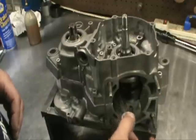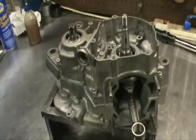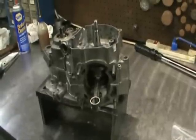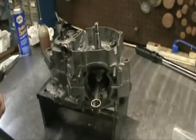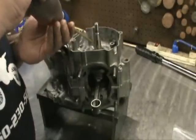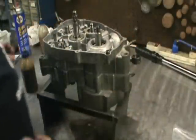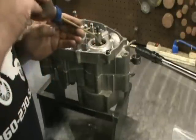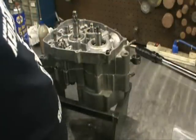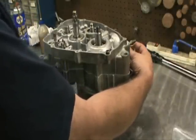The crankshaft is rolling right over. Next I'm going to oil the crank bearings. Anyone that knows me knows I love either Motul or Maxima Super M two-stroke oil, and that's what I use on assemblies — the Maxima Super M. Just get it all nice and lubed up. Believe it or not, there are some pretty famous engine builders — Hall of Fame motocross guys — who actually believe it's better to put a two-stroke engine together on assembly with no oil. I don't believe that, but it comes from a very credible source.